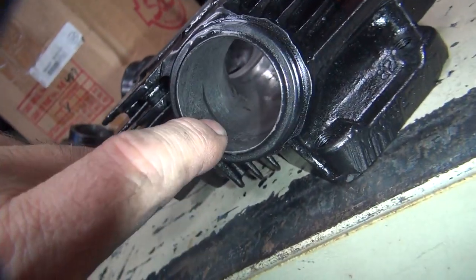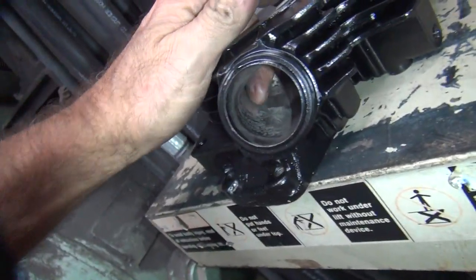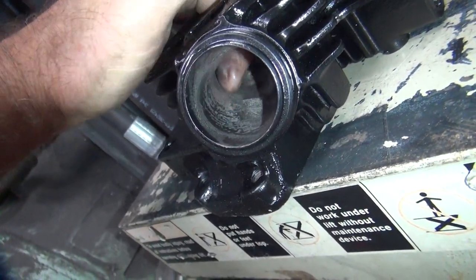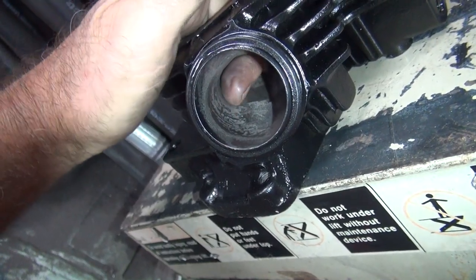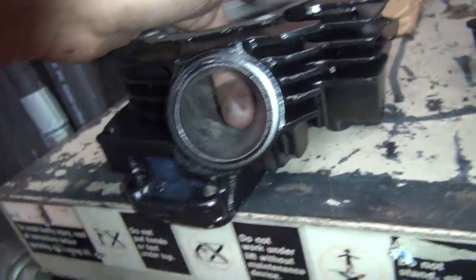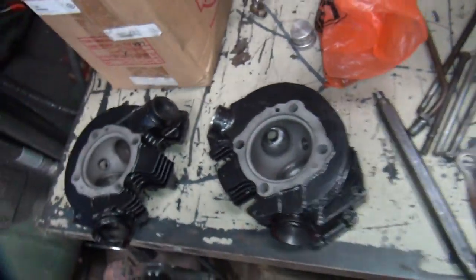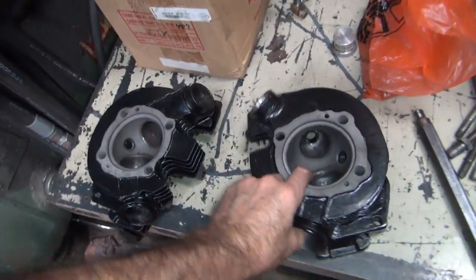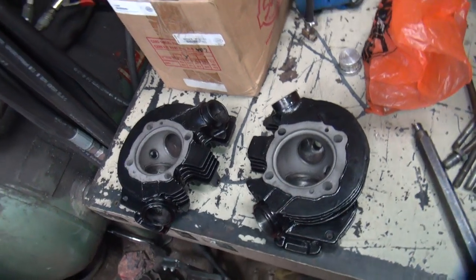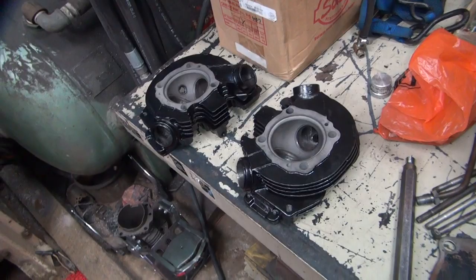Just make it so you can turn — once it goes through the O-ring lip it can turn and go in. This one had that same problem. This was all low through here, so you can see how we blended it. Now it looks more consistent and even. So this one here, you got this big hump right through here — that'll all be coming out through here, so it'll be a straight shot, like on this one over here. So anyway, that's how you do it all. I'm not going to show two more hours of that — I did a bunch of videos of porting already in the last couple of weeks, so I don't need to repeat it. We'll be back after we finish up the other one.